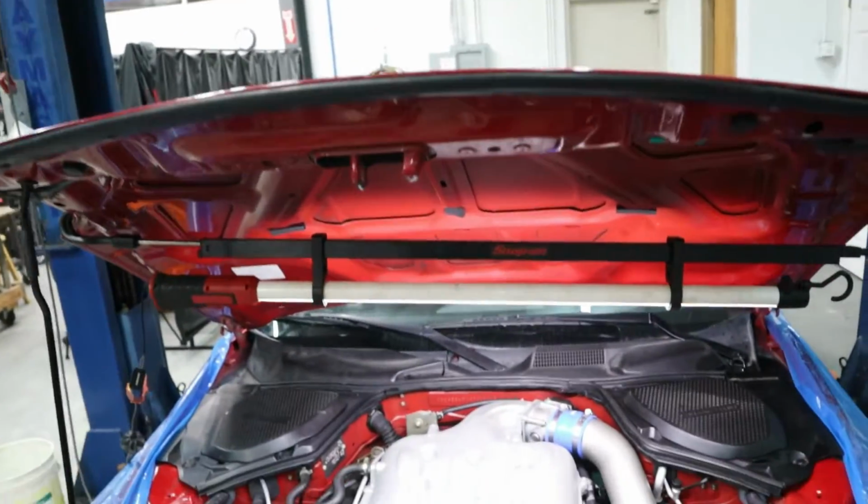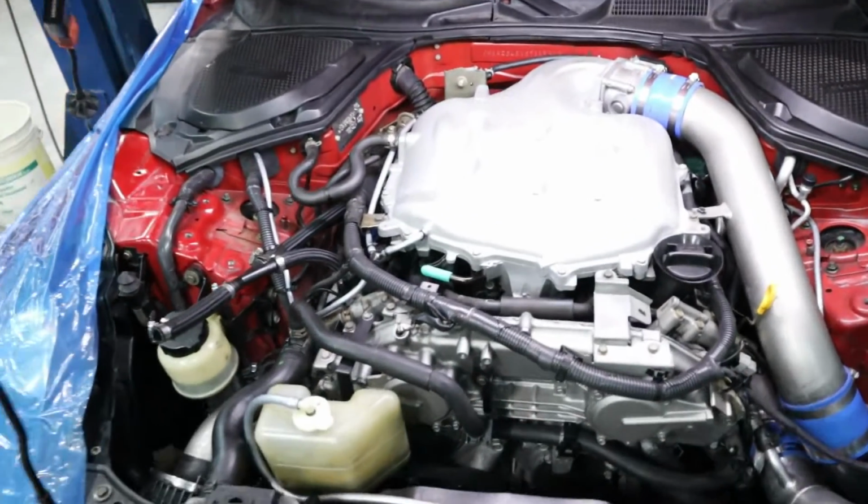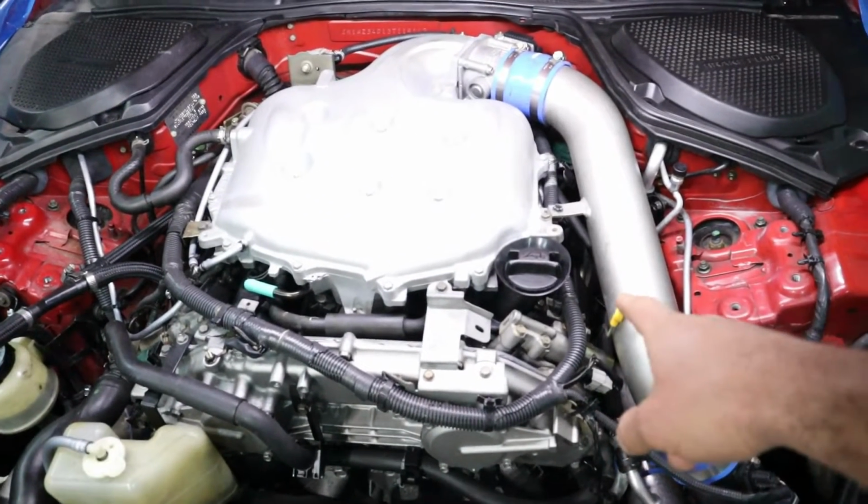We went through it and checked the compression and checked for boost leaks. Compression was good, 150 all the way across. Had a couple of minor boost leaks, so we went ahead and took care of those, then took the car for a ride. Felt a little better, but obviously it needs a tune. We're going to address that in the next video, but for today, we did find a couple of problems.